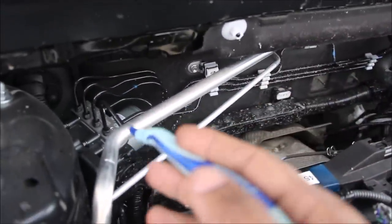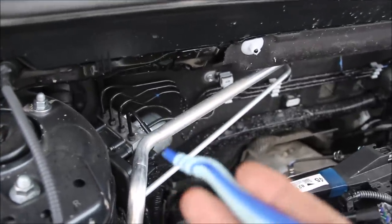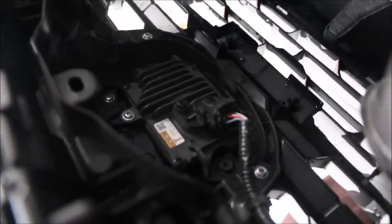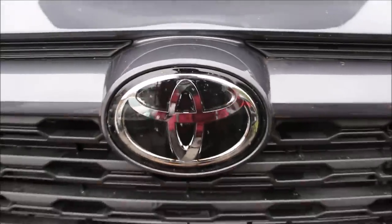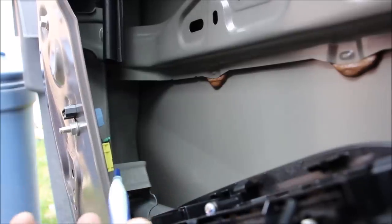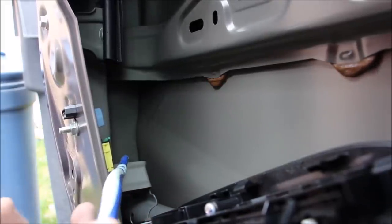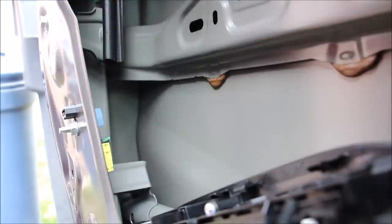Following the brake lines from the master cylinder over to the passenger side, we have the ABS motor which is responsible for actuating the ABS, stability control, traction control, as well as the autonomous braking features on this vehicle. This vehicle has a millimeter radar sensor located behind the Toyota emblem on the grille — that's probably the reason why we're seeing these 2D looking stickers for the emblem on the front compared to classic Toyotas with a 3D emblem. Inside the door panel there's a little airbag sensor that's actually a pressure transducer — when the outer door skin deforms it senses the pressure differential inside the door to determine the severity of the crash and deploy restraints accordingly.